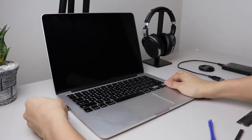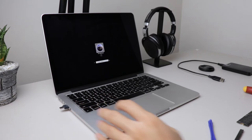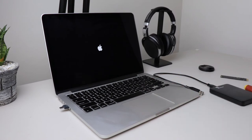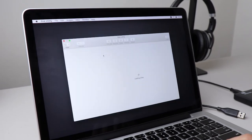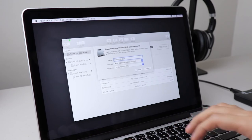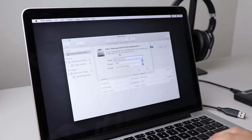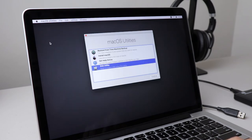Step four: boot to the bootable thumb drive and format the new SSD. Hold the Option key while pressing the power button, and release the keys when something appears on screen. You should then see the 'Install macOS' drive you created — click on it to launch the utility. The first thing to do is format the new SSD. Click Disk Utility, then look for the new SSD in the left sidebar. If you can't find it, go to View and click Show All Devices. Click on the drive then click Erase. For the name, I keep it the same as the old one: Macintosh SSD. For format, pick the volume type you noted earlier — in my case APFS. Leave Scheme as GUID Partition Map. Then click Erase. Once done, quit Disk Utility.